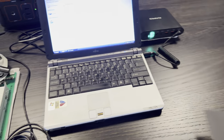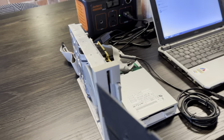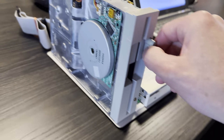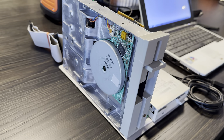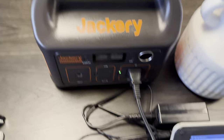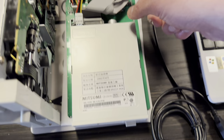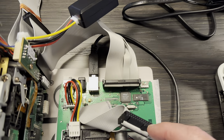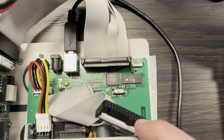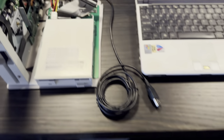A little project I've been working on — a bit of a long story, but brief demo. Here's a five and a quarter inch floppy drive running at 360 RPM, driven by a 12-volt external power supply, connected via traditional cable to a special device: a USB-based external three and a half inch floppy drive, which has a controller chip that includes USB and a floppy drive controller.